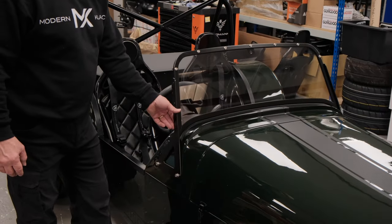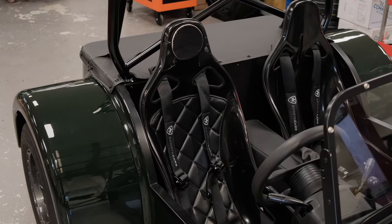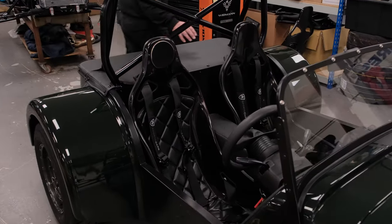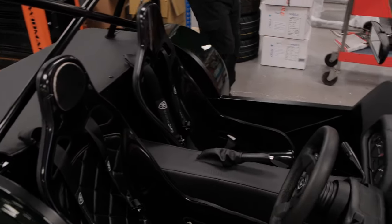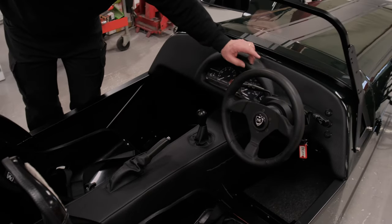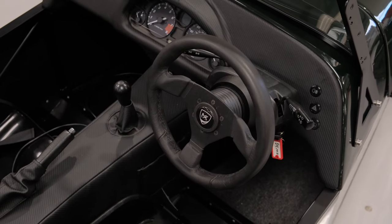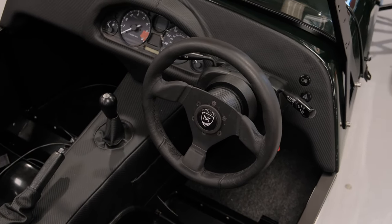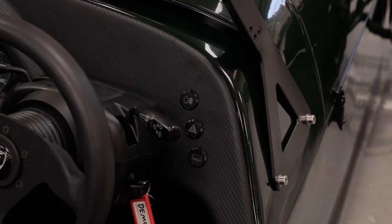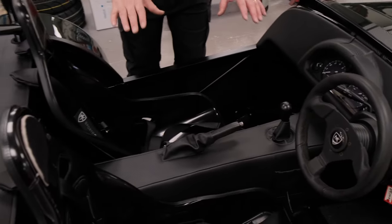It's a final job to do really here. And inside, we've still got the GRP seats — we're going to be changing to the new style seats. In the interior, we've got the boot cover here in carbon vinyl, which is really nice. Nicely padded interior cover. We've actually covered the dash here also in some vinyl. We've got a leather steering wheel, 300mm steering wheel, with the standard instruments here, so you've got all your lights and your little billet aluminium switches in here. And this has actually got the lowered floor pan, so it's about 40mm lower, so you sit quite low down actually.